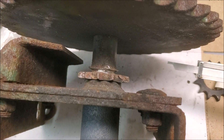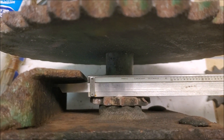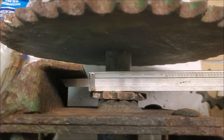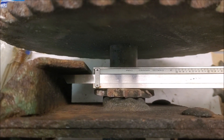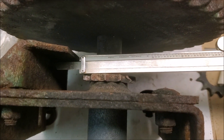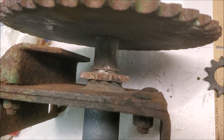After that bit of math we came up with one inch one hundred and ninety-five thousandths clearance. This is why you take the time to calculate it out, because it didn't look like it. I set the caliper at one inch one hundred and ninety-five thousandths — yep, that is in fact what we've got. If we had bought one-inch by one-inch stock we would have had too much clearance, so we're going to look for one-inch by 1.25 or inch by inch-and-an-eighth stock. Hopefully that's available, otherwise I'm going to have to machine it, which is going to be a pain.